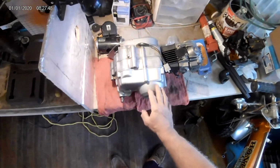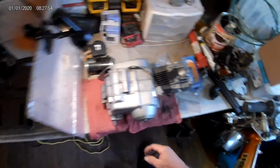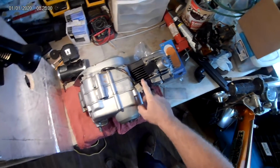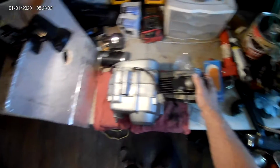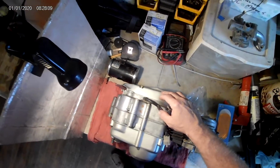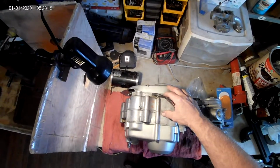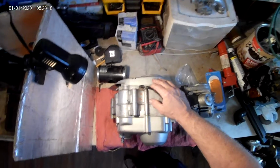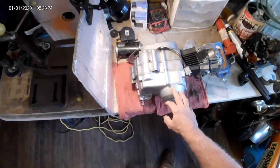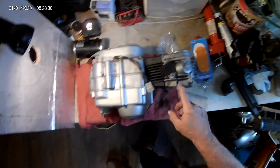I painted these covers, but I painted the body, or the cylinder, and redid everything inside here. Valve timing, I checked the points. I did a test with a test light on the points, and the points are working. I timed it with a light. I checked inside the case and everything, and put new gaskets in. New gasket here. All these new gaskets everywhere.